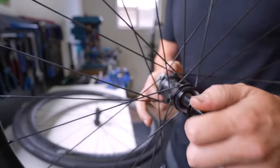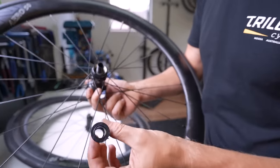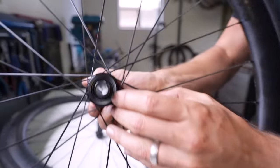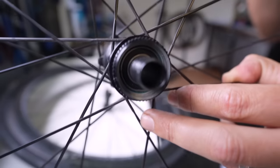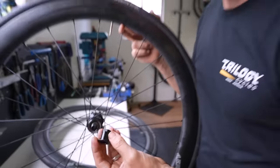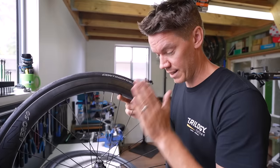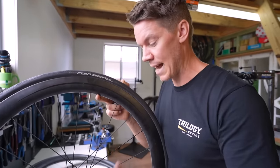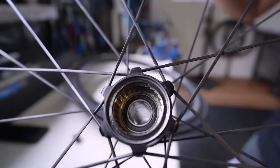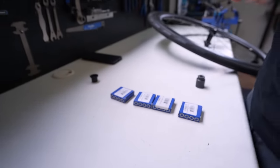This is the hub we showed previously when greasing the end caps — we greased the rear but not the front, and that grease is still there with no rust. Anyone can do this with a new wheelset regardless of brand: just pop the end caps off — most pull off, though this one's threaded — and grease them to prevent water ingress. The free hub body grease is still in there, lightweight, no major rusting.